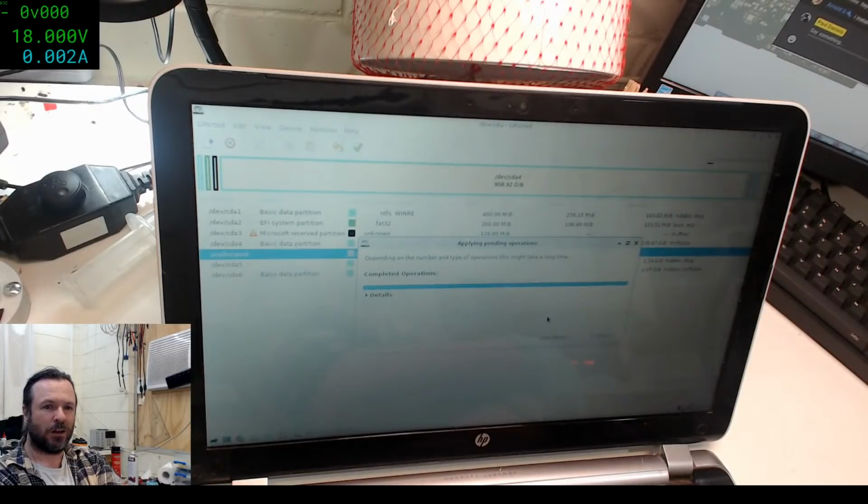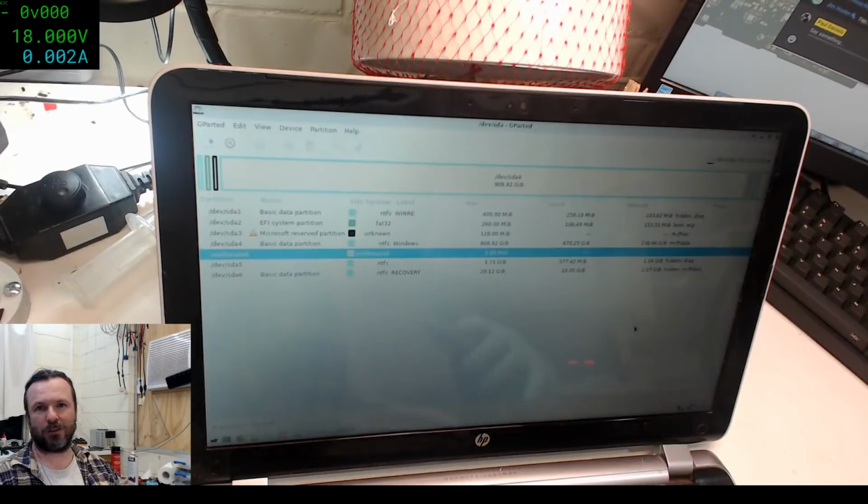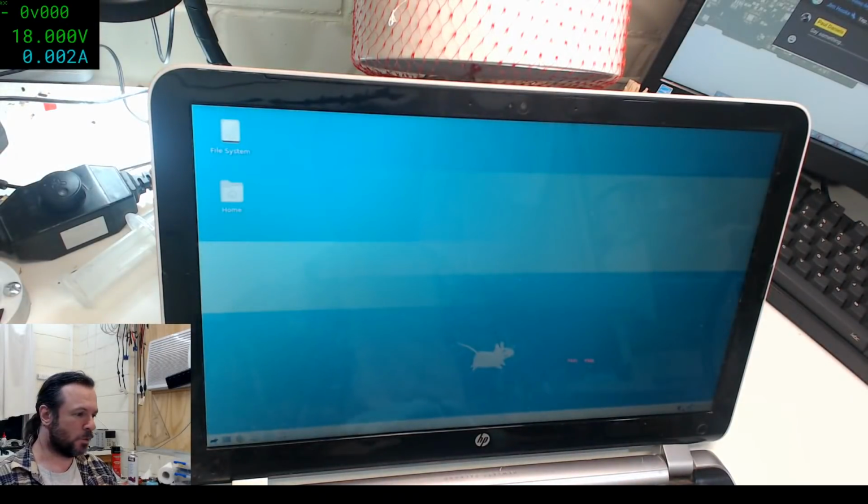Yeah, this was the no power one, which ended up just being a bad brick. But because they said they dropped it, I took the opportunity to take that hard drive out and test it, or clone it into a clone machine, and that's when it came up and said there are bad sectors on it, which didn't surprise me, just purely from age, and then of course the drop itself might have also caused the problem.